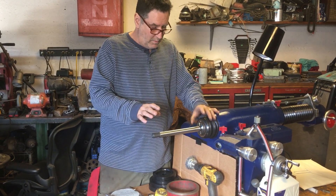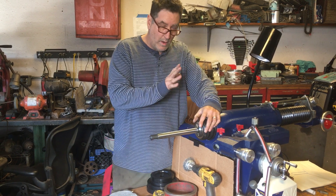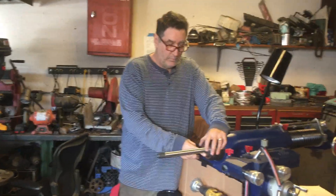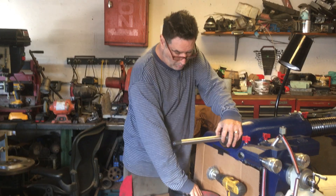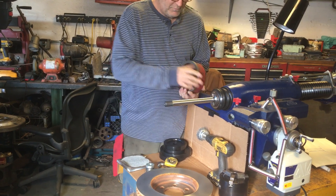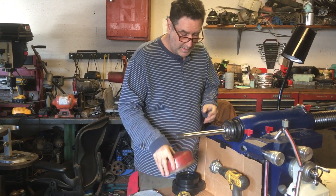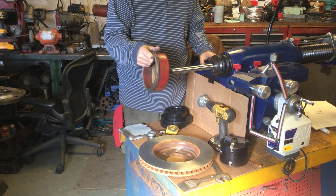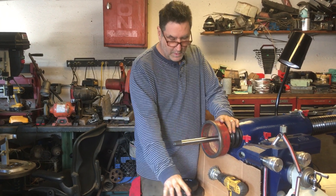Then comes mounting the rotor, and this is a part that provides a lot of confusion for a lot of people. This arbor has one true face on it right here. That's going to be true — it should be absolutely true. If it's not true, it can actually be resurfaced in the machine to be exactly true. The whole matter of having the rotor mounted true has to do with this face and the first cup that you mount your rotor with. There are a lot of other factors like how your cups and centering equipment fit, but the key to getting the rotor on there straight is this first cup. If this is true, everything's golden as long as the rotor is clean.